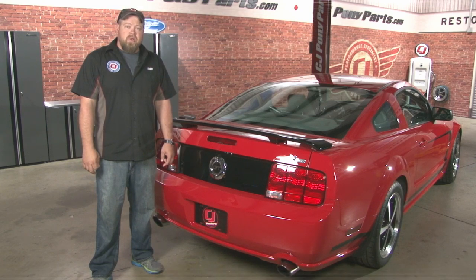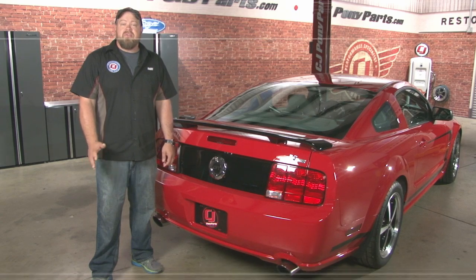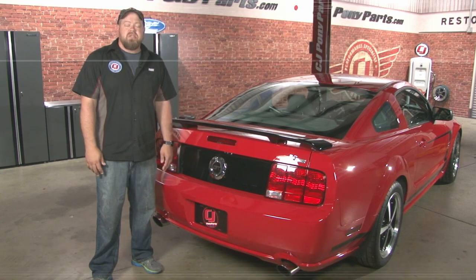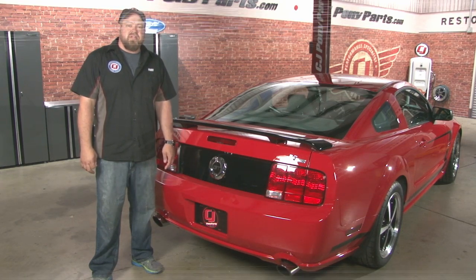Keep in mind when you're finished, you do have to correct your speedometer. If you have a pre-'99 you can do that with a speedometer gear; anything newer will require a tuner. This install is not for everybody and does require some special tools. If you decide to try it, make sure you have the right tools in advance and give yourself the better part of a day for your first installation.